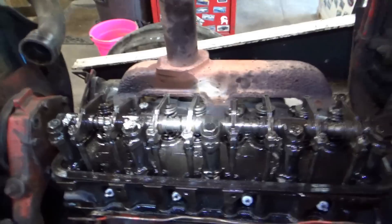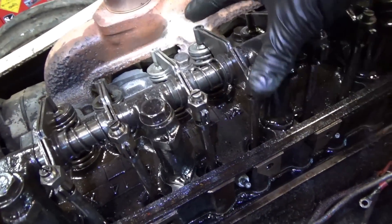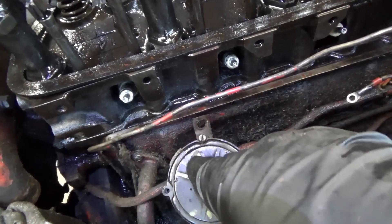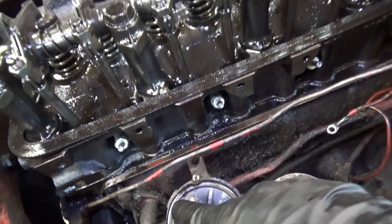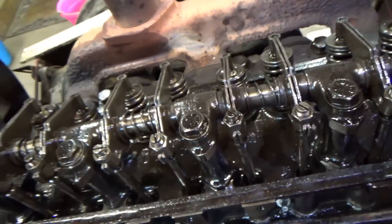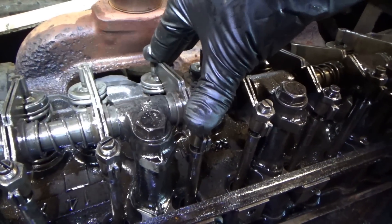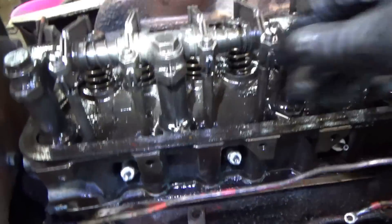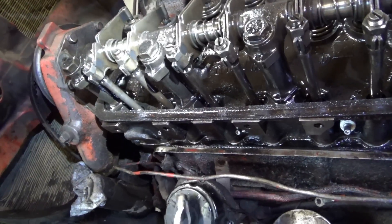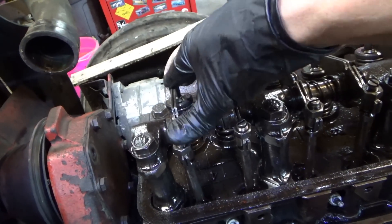I got the cylinder head back on — it only took about five minutes. So what is going on with cylinder number 2? Could the valve clearances be off? I marked the distributor 1, 3, 4, 2, so we're pretty close to TDC. Number 2 is coming up on compression right before ignition. This is exhaust — that definitely has lash. Intake has no lash. Let's keep going a little bit. The intake valve is stuck — there's no lash on it. Boom. So two separate issues: burnt exhaust valve number 1. See, there's plenty of lash there.